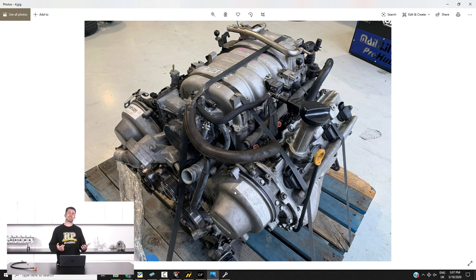No power steering is not ideal. We've got drum brakes all round — again not really ideal, particularly once we do start adding a little bit more power. The other aspect with the stock setup is that it runs a four-speed gearbox with quite wide ratios. It's a bit like rowing a boat when you're changing gear, not really particularly precise. And at road-going speeds you've got the thing screaming — albeit that in stock form, going much over about 80 kilometres an hour is sort of taking your life in your hands a little bit.